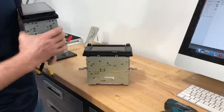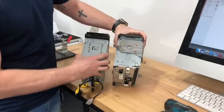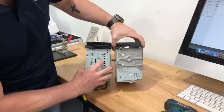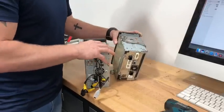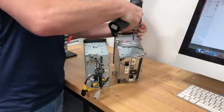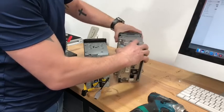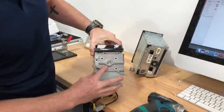You can see it's a really nice upgrade — Apple CarPlay, Android Auto, Bluetooth, Spotify, everything you're really going to need. The quickest way to change them over is to sit them alongside each other. Because they're built for Toyota, the brackets are going to suit exactly the same holes. They use an 8-millimeter bolt — use a Phillips head screwdriver to make sure you don't thread them. You can use the original screws, but they also give you some in the packet.